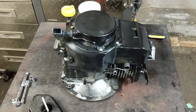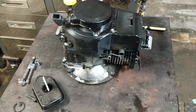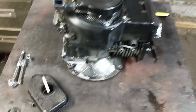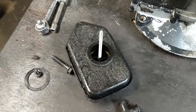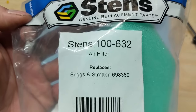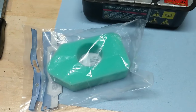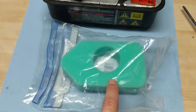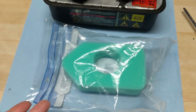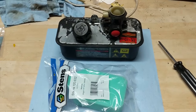The carburetor and fuel tank is now ready to be reinstalled onto the machine. I'm not going to be reinstalling it today because this engine still requires a little bit of work — I want to go over the head bolts and wash it clean to make sure everything on the engine side is good to go. Our air filter is in desperate need of replacement — I can wash the air box the same way I did the carburetor and fuel tank, but I have a brand new air filter here. This is a Stens 100-632, which replaces a Briggs & Stratton 698-369. The green filters you can get on Amazon are cheap but not as nice of quality — sometimes the holes are kind of offset — but it's foam so you can just go ahead and jam it in there.